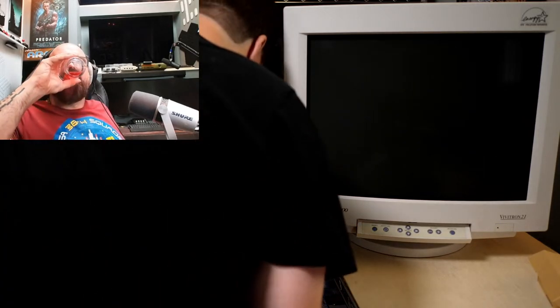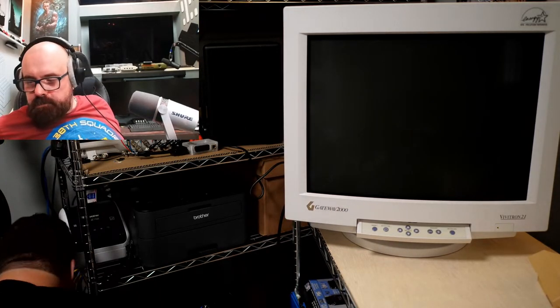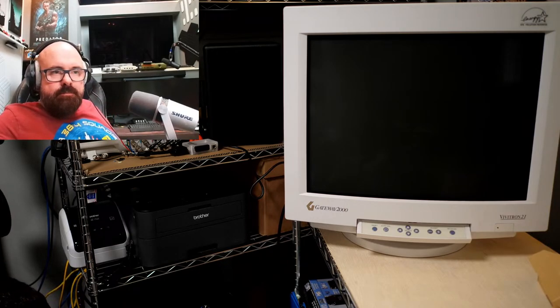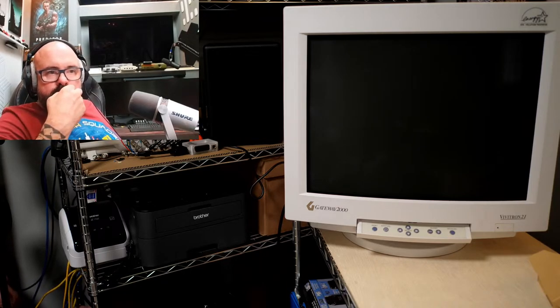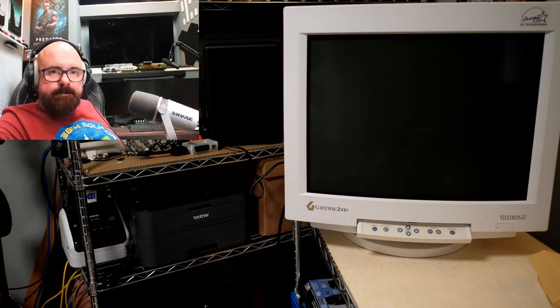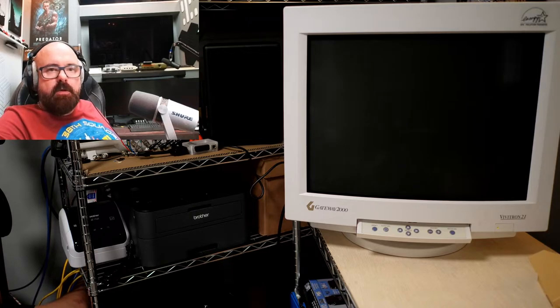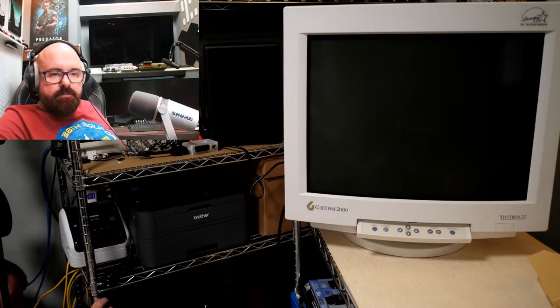Wow, reset didn't even work. All right, let me do a hard kill and back. Give it a few seconds, and I'm also going to plug the USB port directly onto the motherboard. Sometimes there's issues with certain USB things not coming up from the front ports. I've had that happen before, so like you can't enter the BIOS with certain ports.